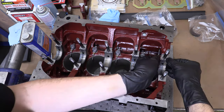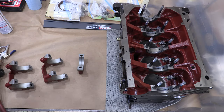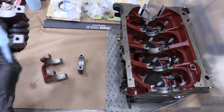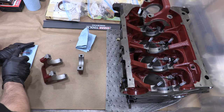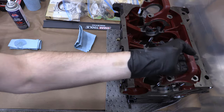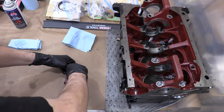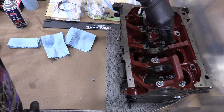I used the blue glove method beyond my normal cleaning routine, and it showed me some spots on the bearings and journals where my cleaning wasn't adequate enough along the way. Dirt or oil of any kind show up on nitrile rubber. So that advice came in really handy for me here. I didn't clean with the nitrile gloves necessarily, but I did follow up my cleaning process with them afterwards, and they easily removed all remaining traces of it and told me if I was done. Yes sir, static free and no lint.